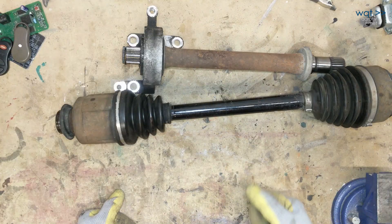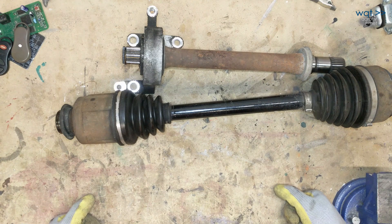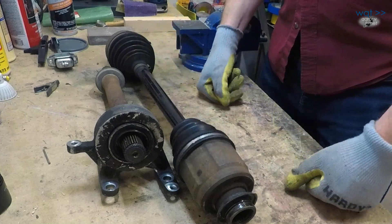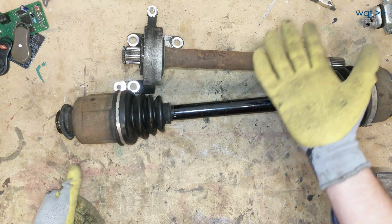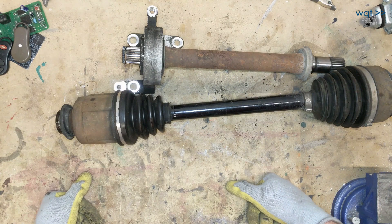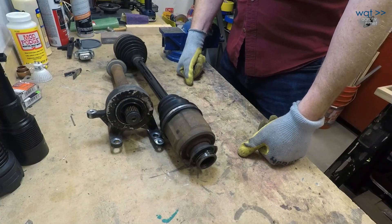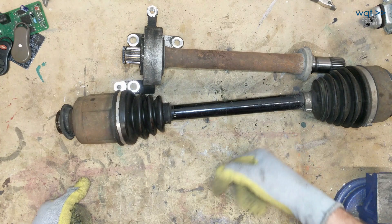So this was a problem, but now we have a conundrum: even though the right front CV axle and intermediate shaft clearly needed to be replaced, they are not responsible for the shaking at the front end of the vehicle — it's still doing it pretty much exactly like before. Maybe the front left CV axle is also bad, maybe the steering rack is going bad. We are finding worn-out parts everywhere on the front suspension as we go, and they do need to be replaced, but so far we haven't found the answer for the problem that got us looking in the first place.